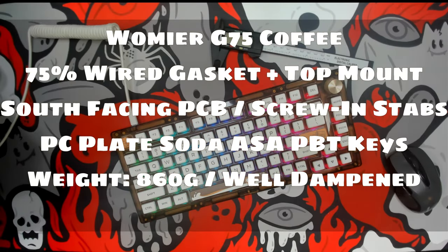Just the specs. Today we have taken a look at the Womier G75, a wired 75% 82 key pre-built from Womier keyboards. It is a gasket mount keyboard with a knob and also preloaded with coffee pre-lubed linear switches and ASA PBT soda keycaps. This keyboard does not include feet, so it has only one typing angle of 6 degrees, while the chin sits at 21 millimeters and the back sits at 33 millimeters. It does have south-facing RGB with 3 and 5 pin hot swap compatibility and does come well dampened with both case and PCB plate foam.